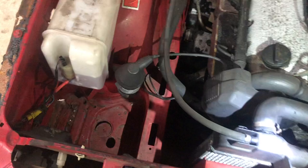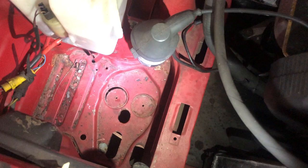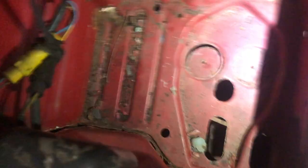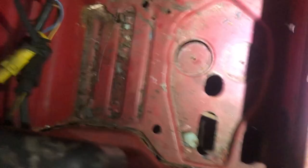Common areas include what we call the C3PO tray. On cars with ABS, this is where the ABS pump is mounted and it is a little more difficult to see. But if you look in the corners you can see down there there is a hole where the tray meets the inner wing. Some of the holes are supposed to be there and some of them aren't, but you can see pretty convincingly that it's all kind of right through where the tray meets the slam panel.